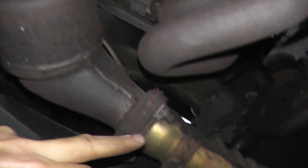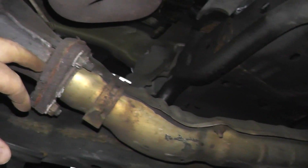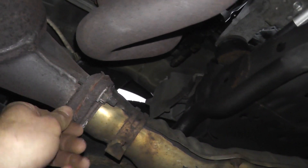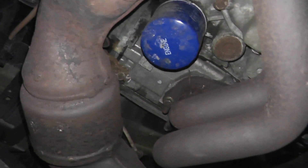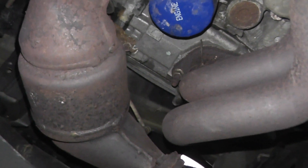Number three is where the catalytic converter meets up to the rear exhaust. It may be a little hard to see because of the heat shield, but the thing about exhaust leaks is you will certainly hear them. Take a visual inspection too — shake it, make sure everything is in good shape. The exhaust looks perfectly fine to me: I don't see any holes and nothing is loose. But there is something else to check, and that's the oxygen sensor.